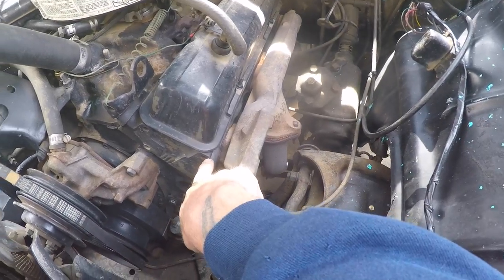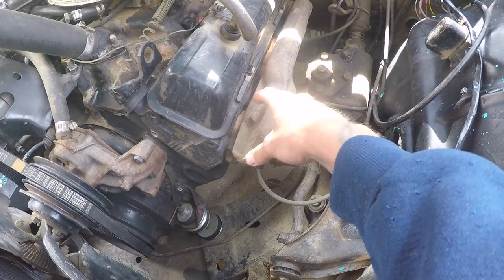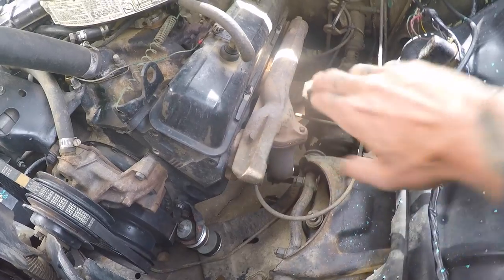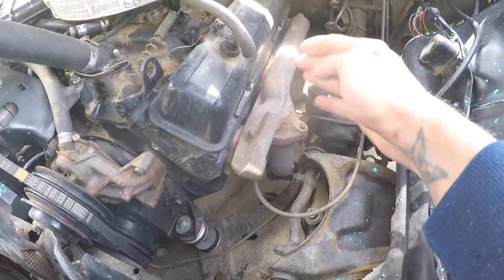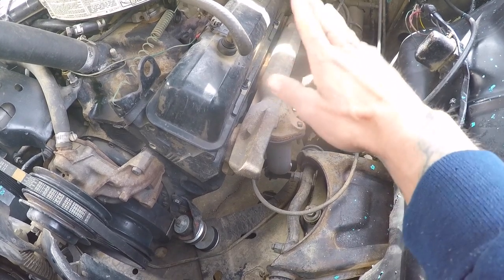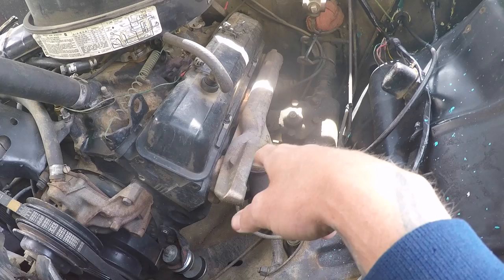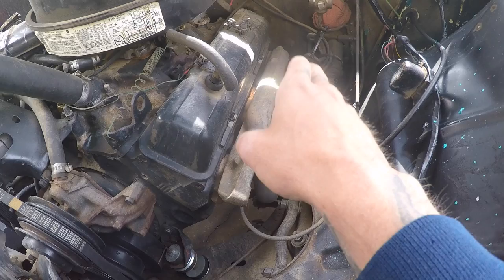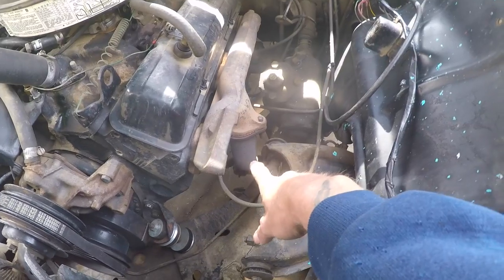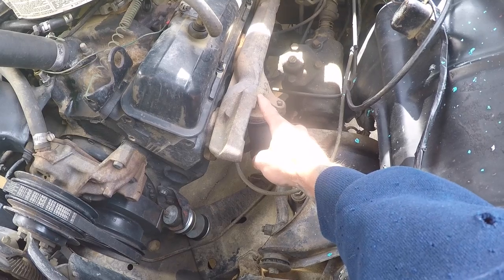As you can see here on my exhaust manifold, there's a gasket between the head and the manifold itself. This can go bad over time just like the intake manifold gasket, so you will need to replace it if that is your issue. You can start the motor from cold and put your hand around certain areas, or even a strip of paper, and you can see the paper moving or feel the exhaust pressure. Just listen for where you hear exhaust — if it's coming from anywhere other than the end of the tailpipe, you obviously have an exhaust leak.